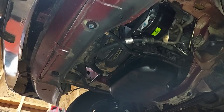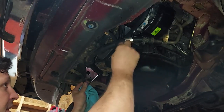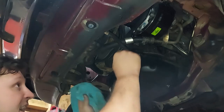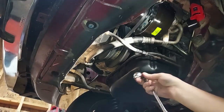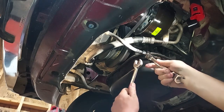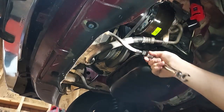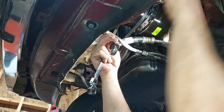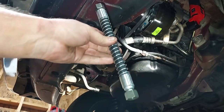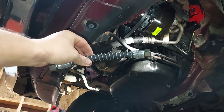Now I'm going to get some low-hanging fruit — we have our new flexible transmission cooler lines. The hard lines run right up here and then these flexible lines run into the radiator. This is very easy to do. Use a line wrench on there and crack that side loose. We don't want to completely undo it because transmission fluid will come out — we'll undo it when the other line is ready to install. Detach that one from the radiator. You can see these replacement lines are wrapped in a steel coil, so it protects the rubber hose — that's why I like to change these.